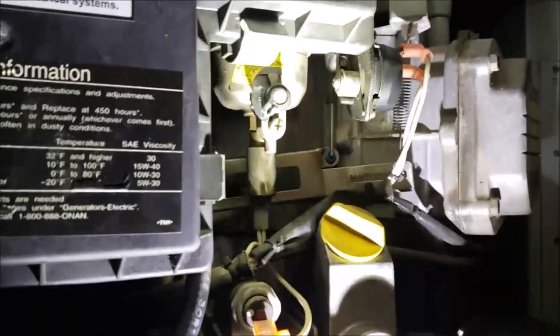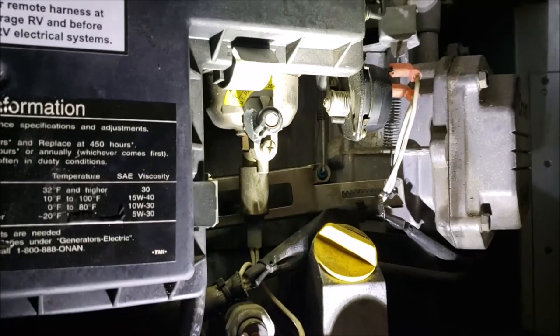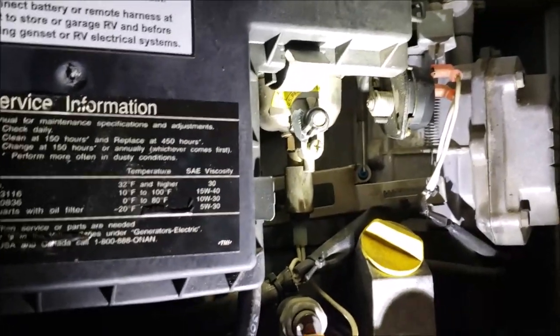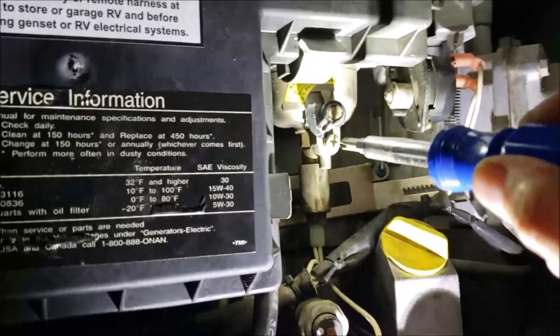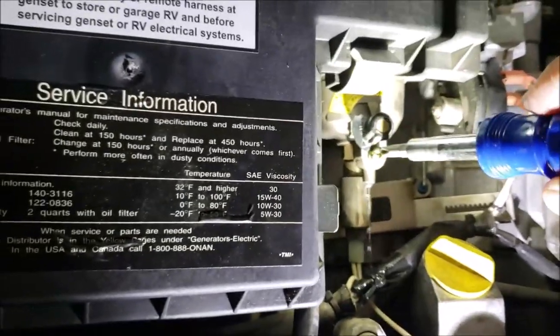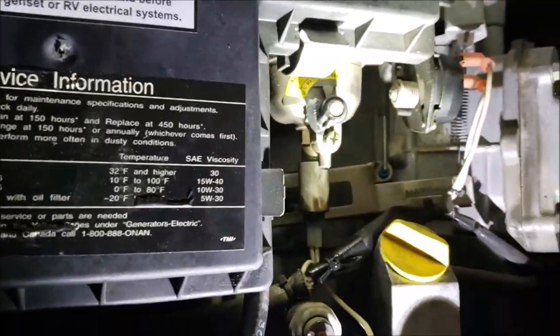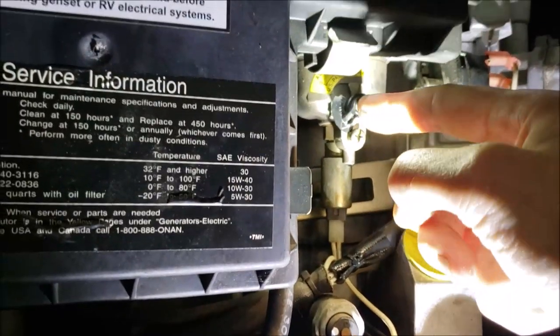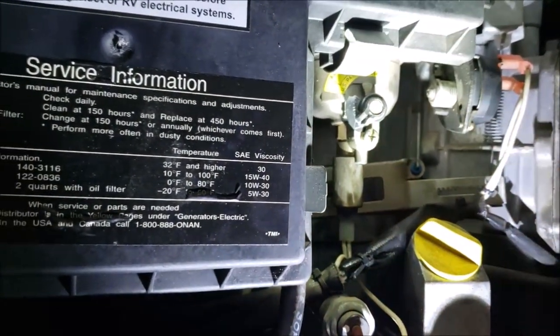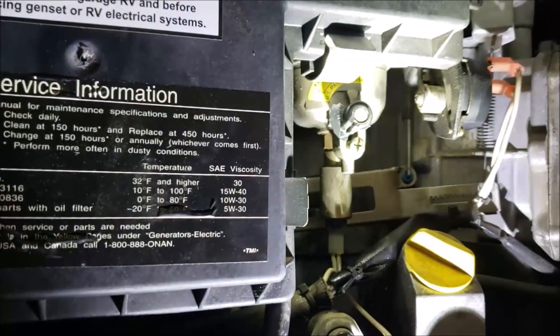Okay, so I've created a surging situation and now we want to fix that. So all I'm going to do — I'll take the drain screw out to catch the gas, then I'm going to take the main screw out and give this just one turn, and you'll notice the surging will go away. So let me just get that screw out and I'll be right back.